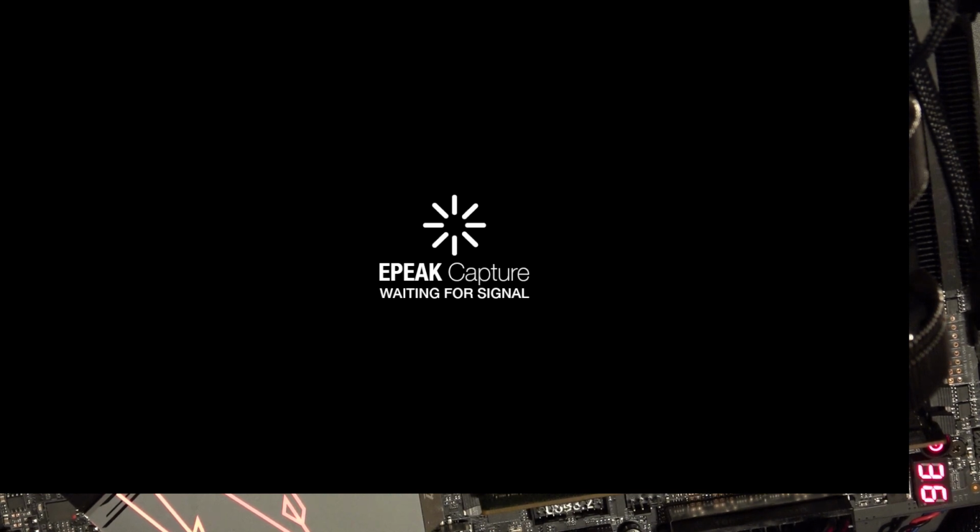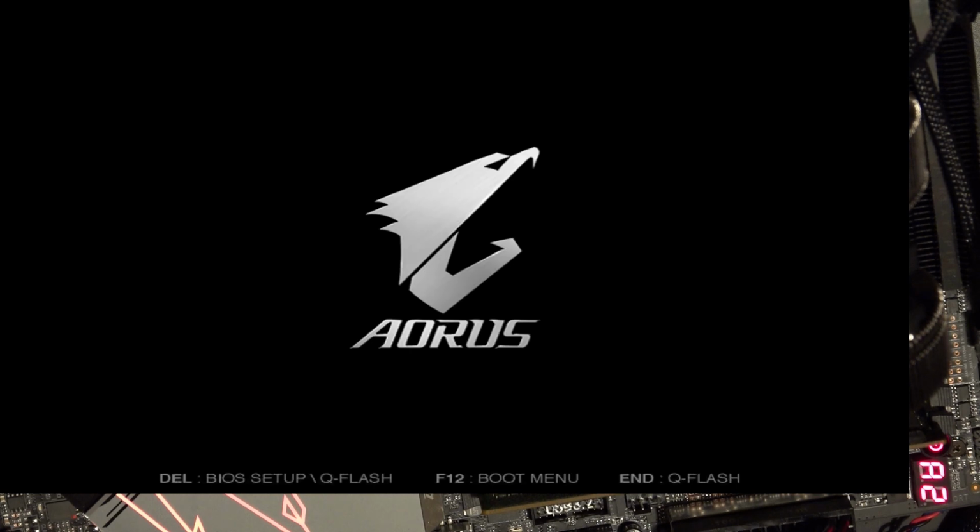And so that still boots right up, so the board evidently was just pushing a bit too much voltage. Well, it boots right up. Yeah, it boots right up. Like at 4600, you really shouldn't need that much system agent or IO2 voltage.